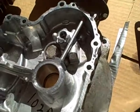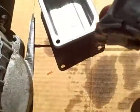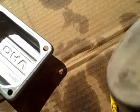Piston — here's the piston. We know the story on that thing. And there's the connecting rod, or what was left of it. But when you look at the piston a little closer, you can see we've got some real wear going on right here on the side of the piston. The rod is obviously gone, and the rest of the piston we're not going to be able to use. I didn't bother to take the rings off.